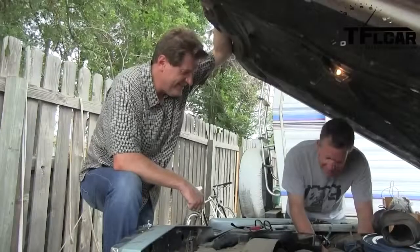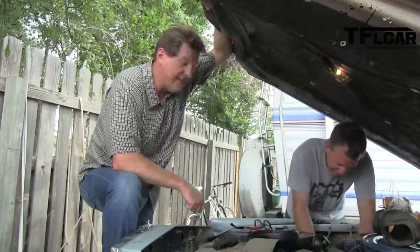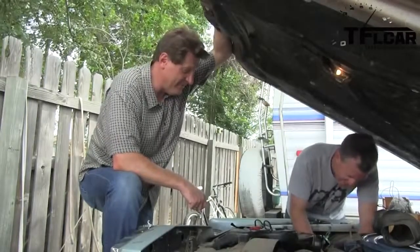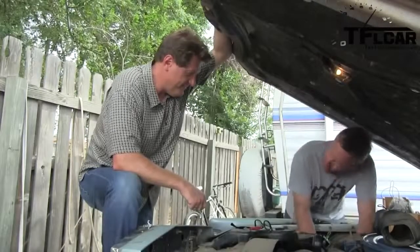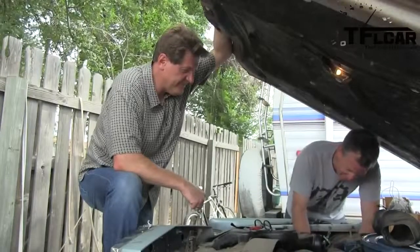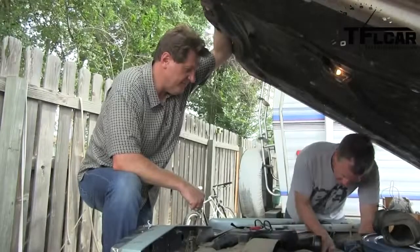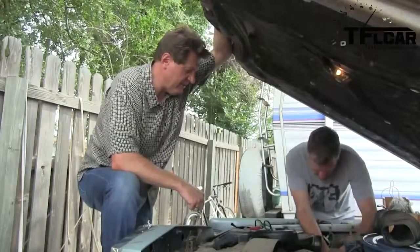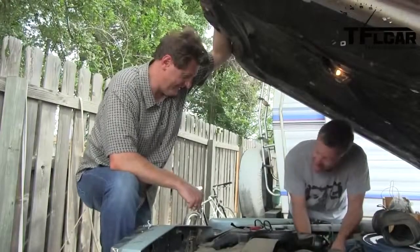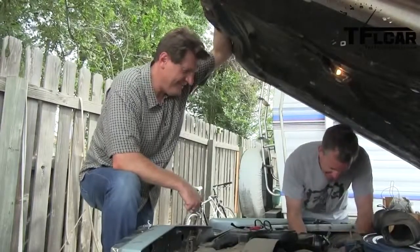It means we can start her up and see if the solenoid still sticks, which it should, because I didn't fix that. But yeah, that's a brand new solenoid we put in. And that wasn't a refurbished one. That was apparently OEM. New parts are just a good place to start. By the way, I'm taping up my earlier transgression here. Good to have sound electrical connections, or at least buried electrical connections that the next guy can diagnose. We still have to fix the mouse tube part. Yeah, we've got that voltage regulator in our future.